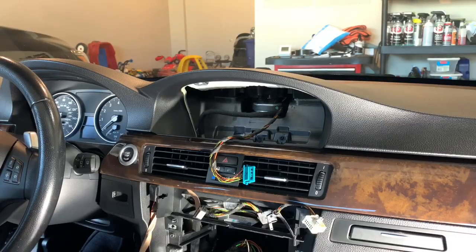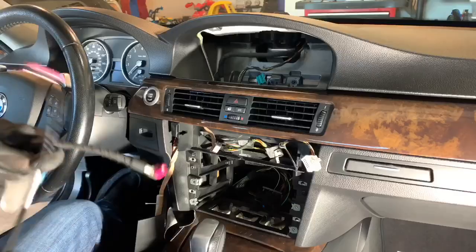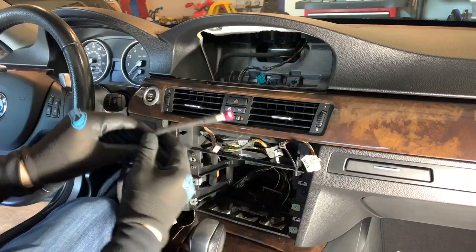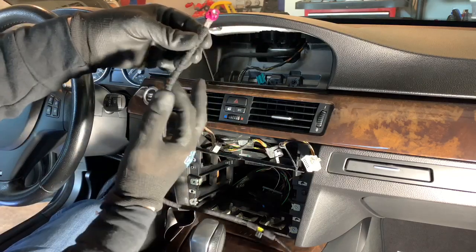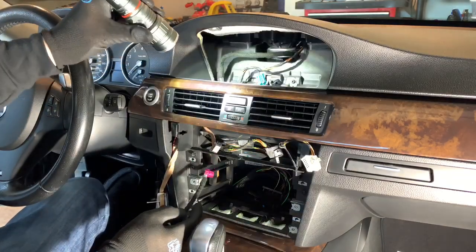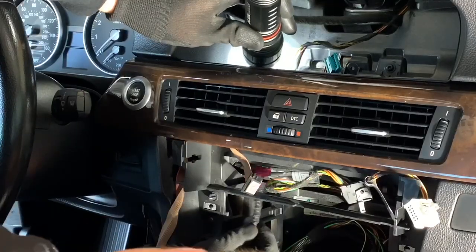With that done and out of the way, now we have our new connector here. It's gonna go with that. All right, now we need to run our pink display cable up through and connect the two here. Now this side will go up, that has the tape on it right here, and the little shortcut path. I'll remind you, a lot of this is a very tight squeeze, but a small little path is right here.